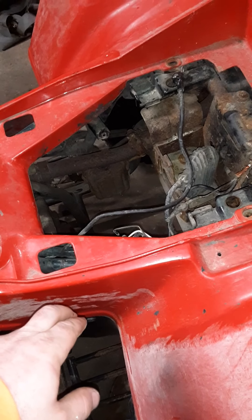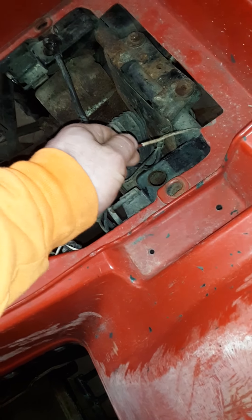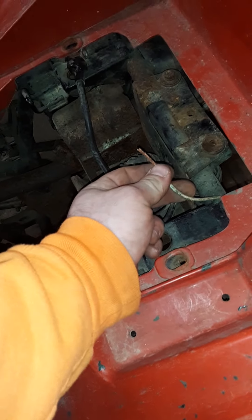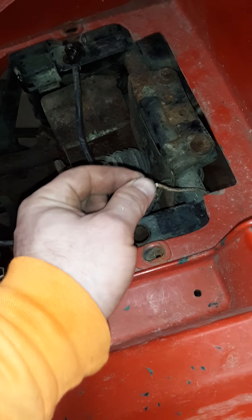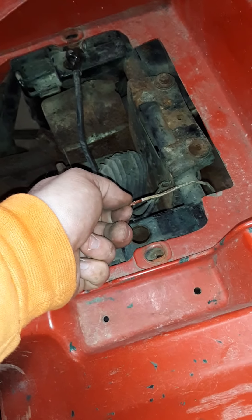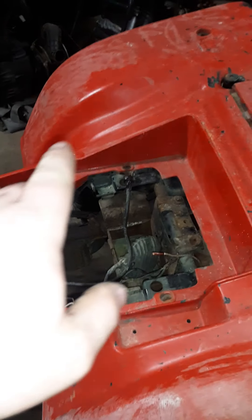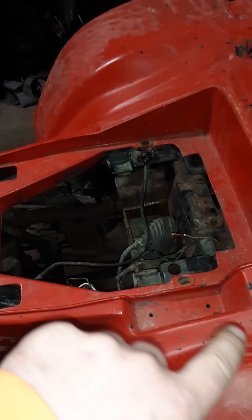It's missing the solenoid and the wiring to the solenoid. I figured out that this white wire here, if you run positive to it, this is what feeds the wiring harness. My guess is this would get ran to the positive battery cable, or it would go to the solenoid on the battery side. I'll put a connector on it and probably run it to the starter solenoid on the battery side. You've got battery side and starter side — one cable comes from the battery, the other goes to the starter. So I'd be running this to the battery side.